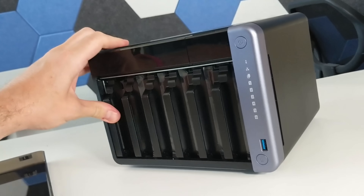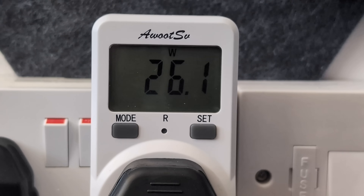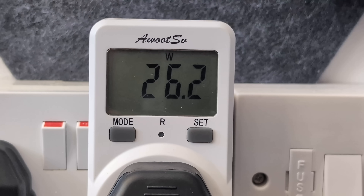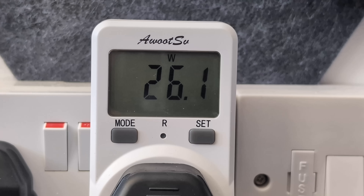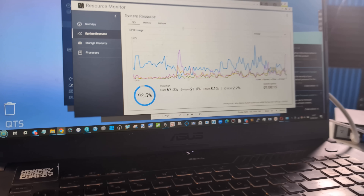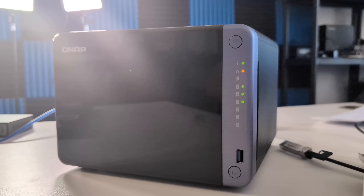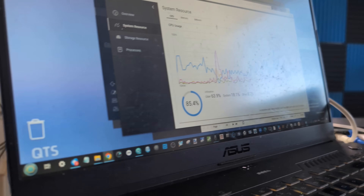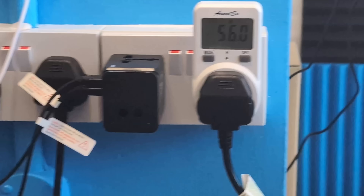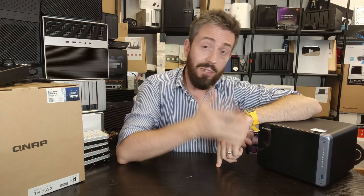With the four hard drives in RAID 5, fully synchronized and nothing else going on, it reported just 26.2 watts average power consumption. When I ran heavy activity - during initial RAID building with heavy read and write, so parity had to be utilized during synchronization, with the CPU at around 80 to 90 percent at all times - that number went up to 54 to 55 watts. That's relatively high, but for a six-bay device going full blast, it's actually not that bad.